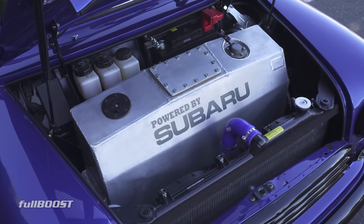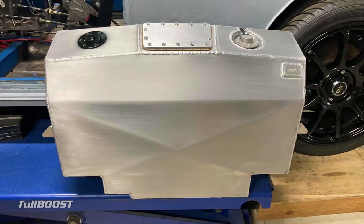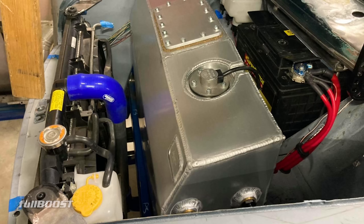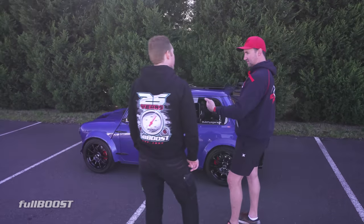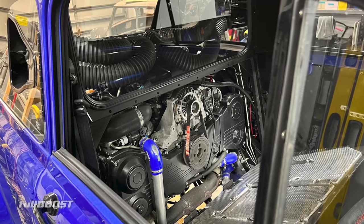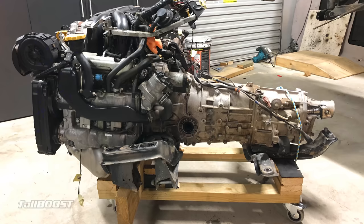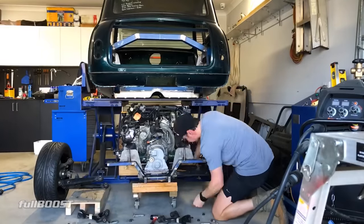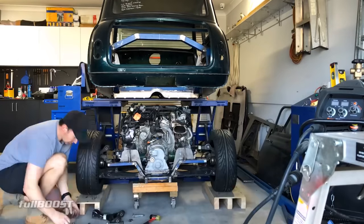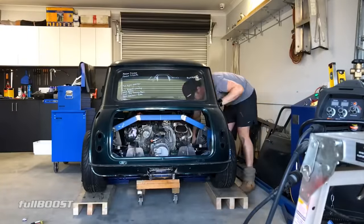Is there an issue having petrol in the front of the car for engineering? No, it's fine. I built the whole car myself — the only thing I didn't do was the fuel tank, for engineering purposes. Being an EJ engine, it sits low and flat. Being a boxer, the centre of gravity is quite good. The engine sits right in front of the wheels — I'm using the front axles of the Subaru five-speed transmission to run the rear wheels, so it's transmission then engine in front. It actually balances — it's essentially exactly how it sits in a WRX.